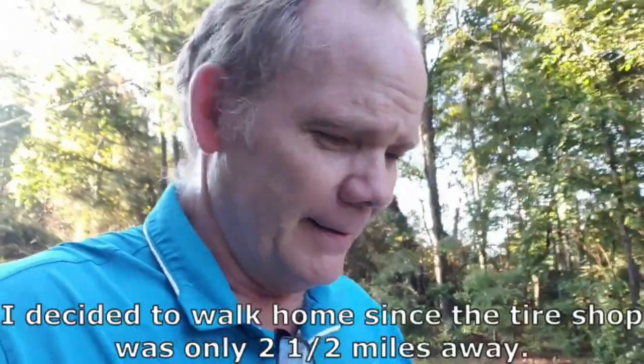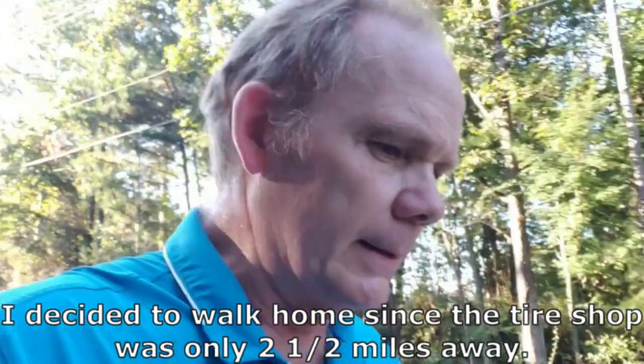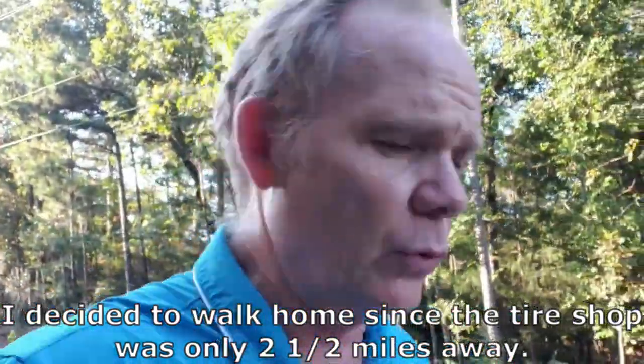Well, good morning. We're back at it. Just dropped the old Cadillac off at the local tire place. They do alignments as well, and I did some reading. I think the setting is anywhere from -3 to +1 degrees on the caster adjustment. That's really the only one I'm worried about. Not really worried, but mildly concerned, to have the best drivability.